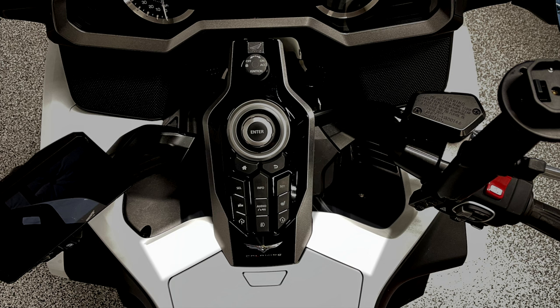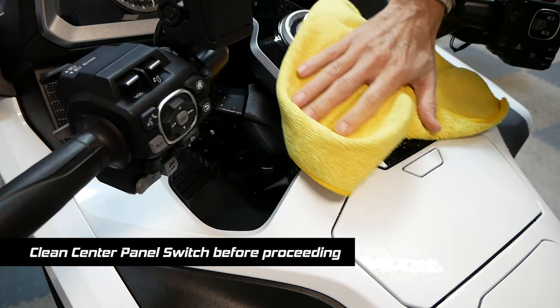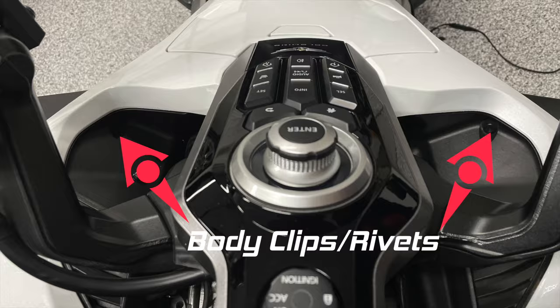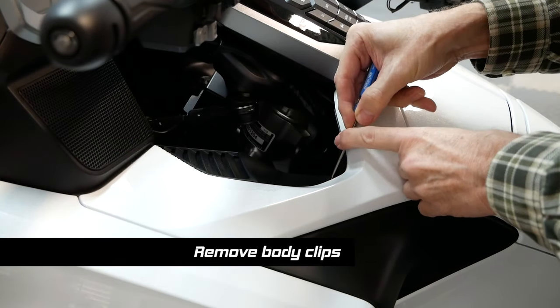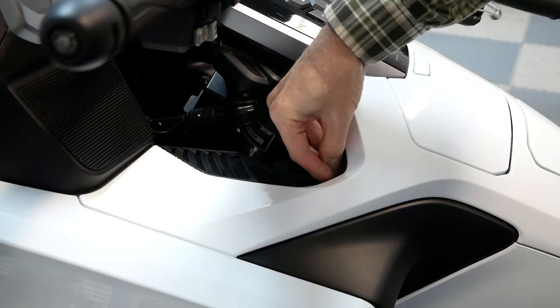It will also give us access to those pushpin rivets. Before we move the center panel switch out of the way, I like to clean this entire area with some water and a microfiber cloth so that if there's any dust on the surface, we don't get parts scratched. I want to start by removing the two body clips — there's one in each corner, kind of on the inside underneath this shelter. They're hard to photograph and hard to see, but you'll find these two body clips. They're like little plastic rivets. You poke them in the center with a pick and then use your fingernail to pull them out. If you're not familiar with these body clips, check out my Goldwing maintenance videos for a complete description of fasteners and body clips.